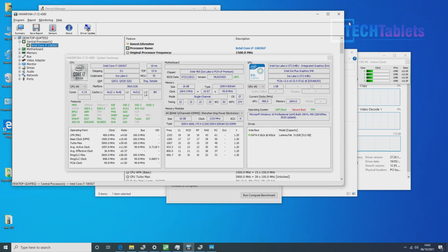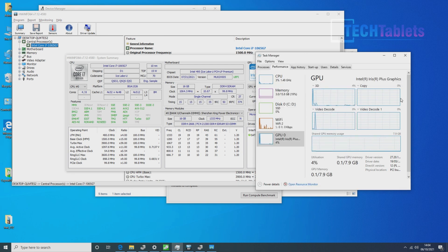In Windows — it's running Windows 10 Pro, activated, no problems. However, there are several issues. The Core i7-1065G7 is Intel's first 10nm chip — quad-core, eight threads, 3.9GHz max turbo — but if you have a keen eye you'll notice it's a QS, meaning this is actually a quality or engineering sample chip that should not be in retail units. The GPU is the Ice Lake GT2 with 64 execution units — Iris Plus graphics. But it's crippled by running in single-channel, and the RAM is at 2666MHz rather than the 3200MHz this chipset actually supports.